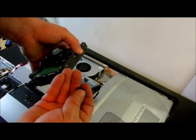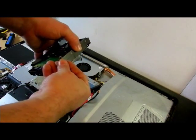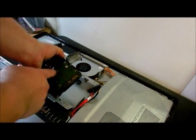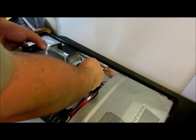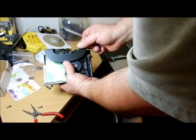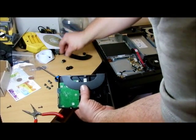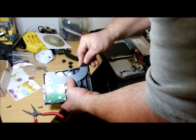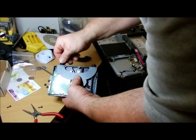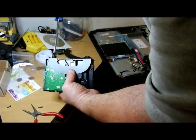Something to remember: these right here are bumpers, and they were in like this. This piece right here — it looks like cardboard or padding of some sort — is on top. It sits like this so when the cover comes down it's hitting this padding. The connector is upside down — connector is this way, and this has to go back on that side when you put it back together. I'm going toward the connector on this side and putting the handle back on. I have the screws going in here. You grab the two without the cardboard and go ahead and put these back on — you can finger tighten them first. Do not touch that circuit board; static electricity will damage it.